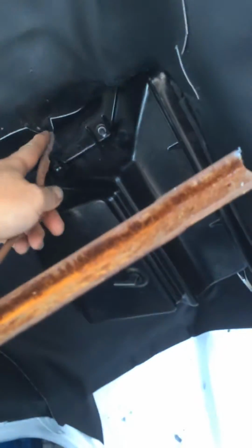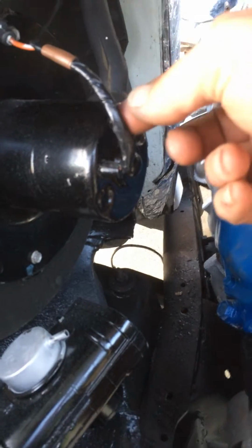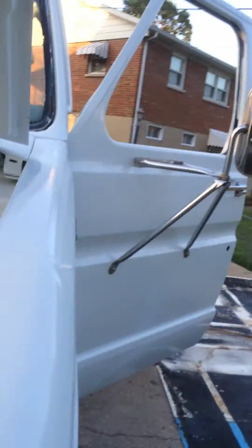All my wires on the inside. As I'm doing the wires on the inside, I'm color coding them, and this particular one's brown. On the other end of this wire, I'll just go ahead and show you how I'm doing it. And this isn't so much for me, but for someone else working on it. I've color coded this brown, so I'm using black on all the wires. And in fact, we can just go ahead and hook this up. This is the resistor, and there. And you can see, like I said, I've color coded all that black. I already cleaned these connectors. Need to hook up my ground, but just working across the dash.